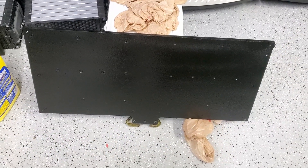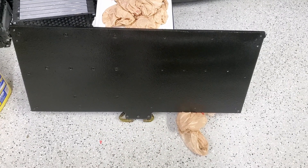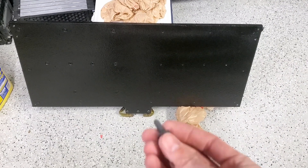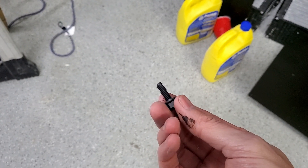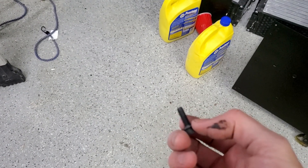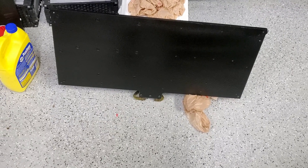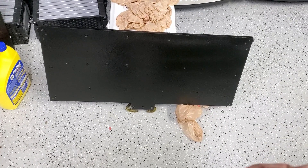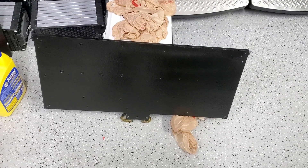This is my rear cooling plate here. Even though the anodized surface doesn't conduct, if there's any scratches or nicks, or even the heads of screws, so I just put a coat of the rubberized undercoating. I've also got some screws here that are non-conductive, so I'm going to fasten that to the chassis. Before, if I touched the chassis and touched one of the coolant connectors that goes inside, that would conduct. I could see this acting as a big capacitor, building up a lot of charge, and then when you turn on the car, it kind of immediately discharges. But there's a way to just try and isolate further any electrical issues.